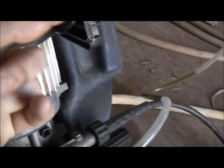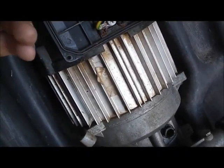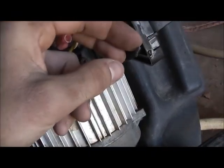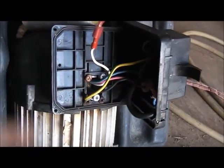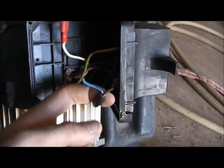That just bloody broke off there — it's an Italian made unit. They should have at least put a little bit more effort crimping those wires on. The capacitor's definitely stuffed, but that's not the only problem — it ran open circuit, hence why it blew smoke and the motor won't start. It's got the brown and the blue wires — it's exactly the capacitor I need from eBay. It's got the exact wiring on it and everything, so that looks identical to this one.